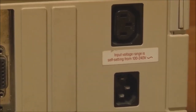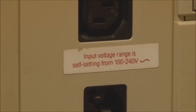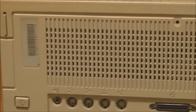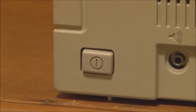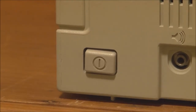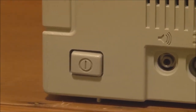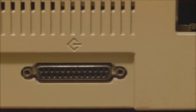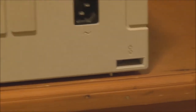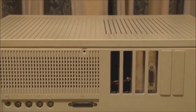Over here we have the power inlet and monitor power output port. This is an auto-ranging power supply. Then over here we have the power on switch. Just like the 2 and the 2FX, the 2X supports soft power, so we can turn it on either from the power key on the keyboard or from this switch here. Notice that, unlike the 2CX and the 2CI, there's no provision for locking the power button in the on position, which is a bit of a shame. Over here we have the ports: audio out, two ADB, printer and modem serial ports, and external SCSI. We also have a security lock connector.